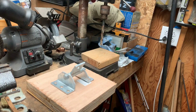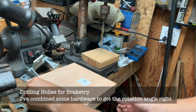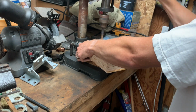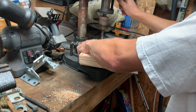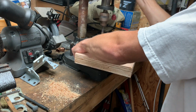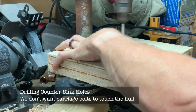So the problem with the brackets that we had is they were set up for being attached to horizontal cross members on the trailer, and that's not the way the trailer is set up. It doesn't really have any horizontal cross members. The 2 or 3 that are there are L channel and not box, so they're not set up to be wrapped around with a U-bolt, and I do not want to drill holes in my galvanized trailer because that's a rust spot, or a potential rust spot.